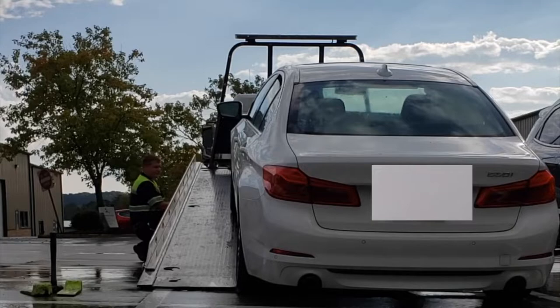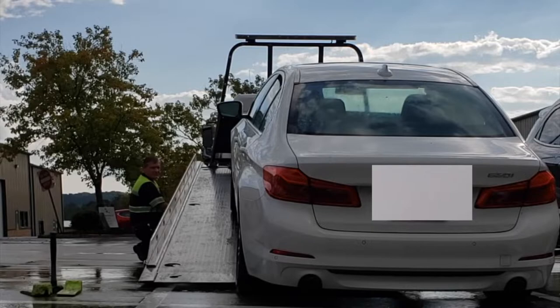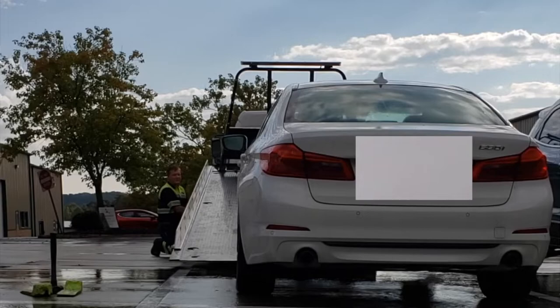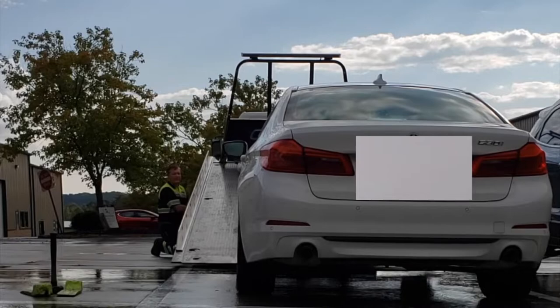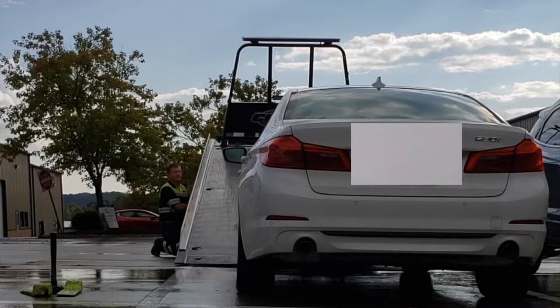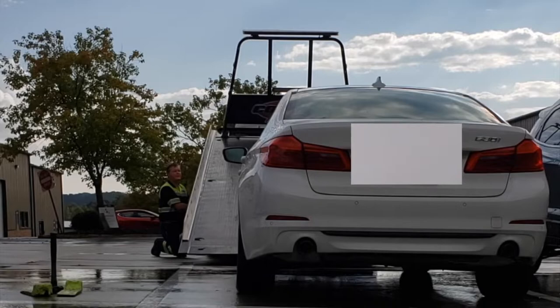The angle of the bed will help the skate get started. However, sometimes you may have to walk the vehicle off utilizing the bed — extend the bed out, slide it forward, then roll the vehicle and the bed back a little bit more, working your way to get the bed right out from underneath the front or back end, however you have it loaded. It's no different than unloading a shed or a piece of equipment, where shaking and jerking is not beneficial.